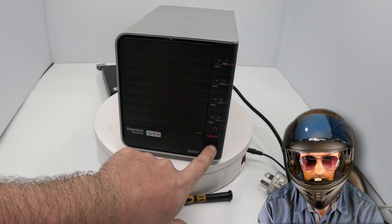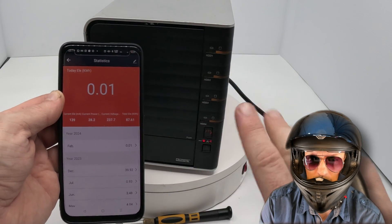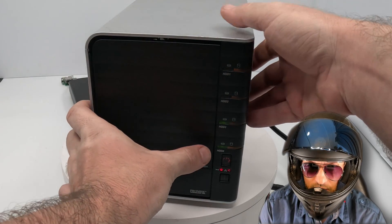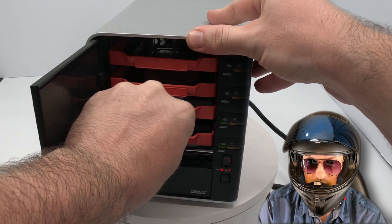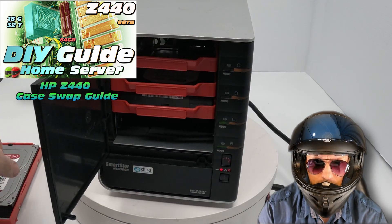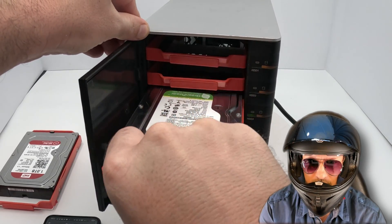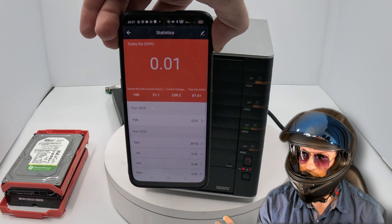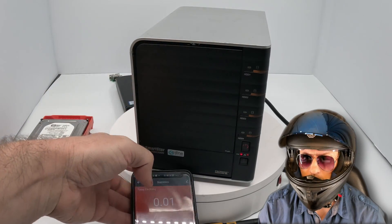It came down to about 28 watts. I thought a NAS was meant to be low power draw. Let's do our test - we'll take out one of these hard drives. Taking out one hard drive, we lose maybe two or three watts. Taking out another - okay, 21 watts. Pretty decent numbers, but those hard drives are pretty heavy on the power draw. They do draw quite a lot. But we're not here to talk about a NAS - I'm here to show you how to take this NAS apart in a future video.